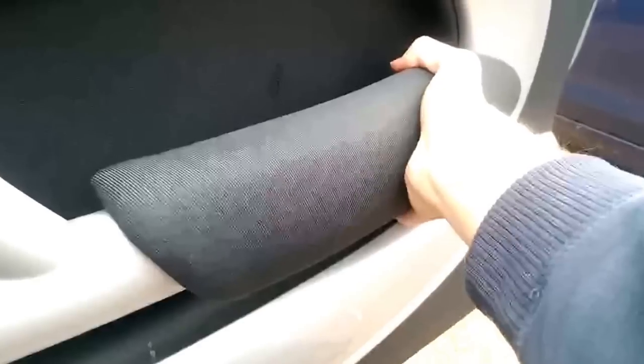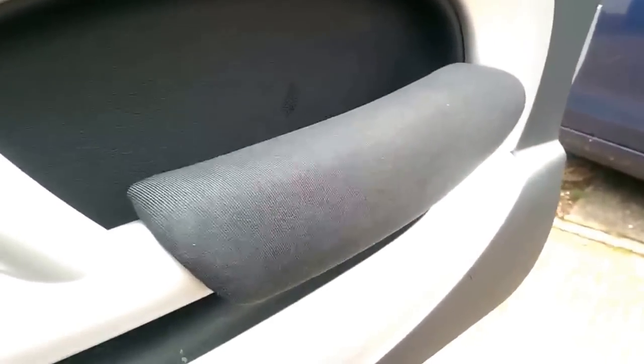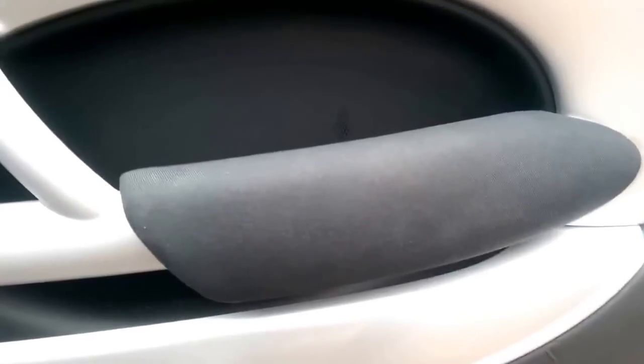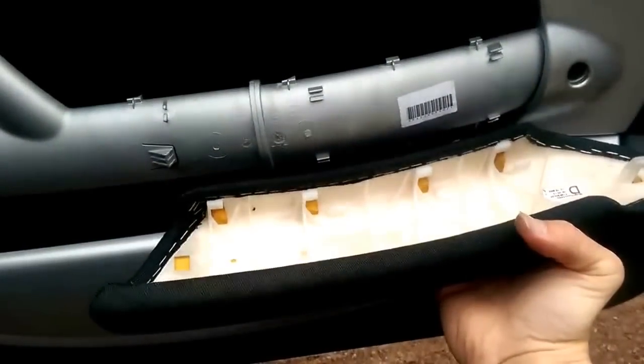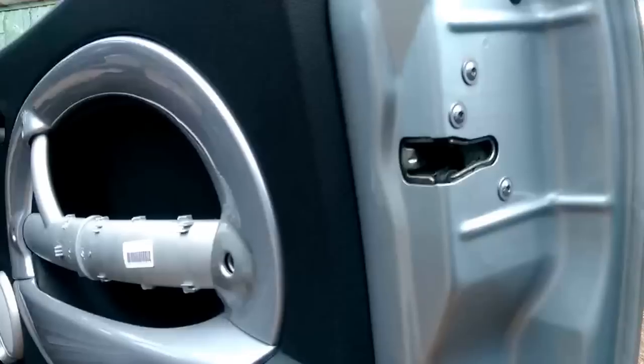Here's pretty much the toughest part to remove. The armrest or arm cover has got a clip on the left hand side just below my thumb, and basically you need to push that in and then slide the whole unit left, and hopefully that will reveal the last bolt that's underneath. You can see on the plastic trim there's a little square raised part - you need to push that in through the material to enable sliding it left.